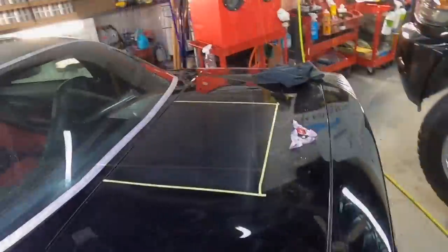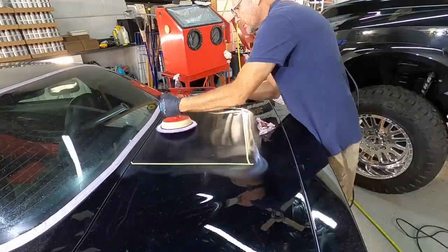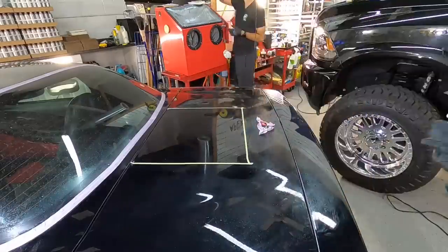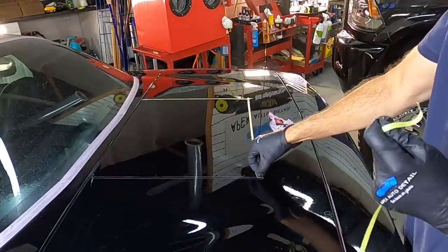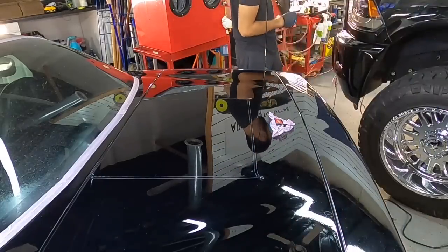Let me pause here for just a second. Even after the test spot we did with the rotary, a wool pad, and wet sanding, we can still see — let me pick out a spot — the etching still runs deep down into the clear. It's a two-layer factor: the first layer is the deposit itself — could be calcium, limestone, or anything really — but it also etches and eats down into the clear, sometimes even down into the color coat itself. I'll explain in the next video exactly what happens and how it etches into the clear, so stay tuned.